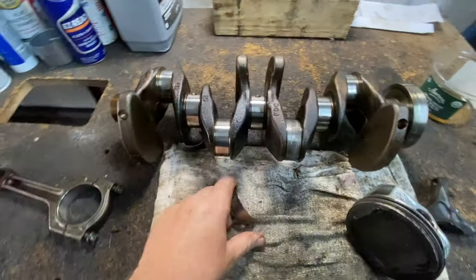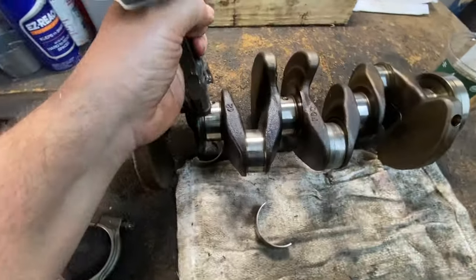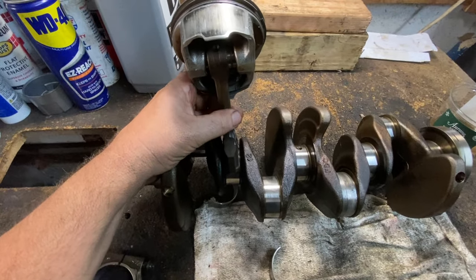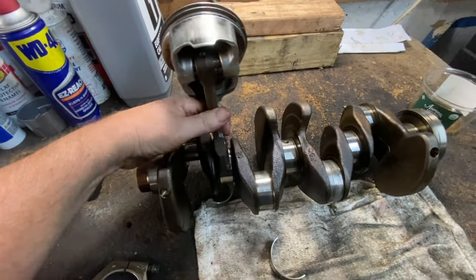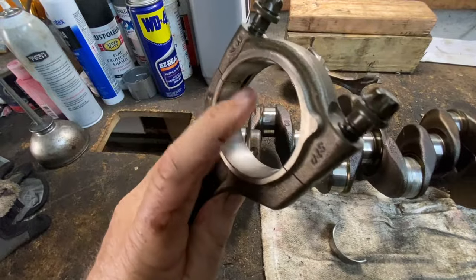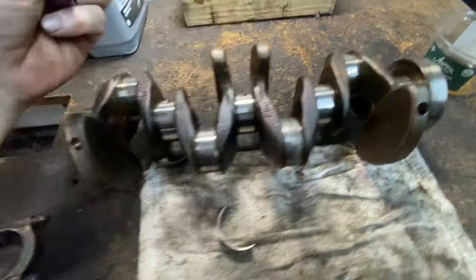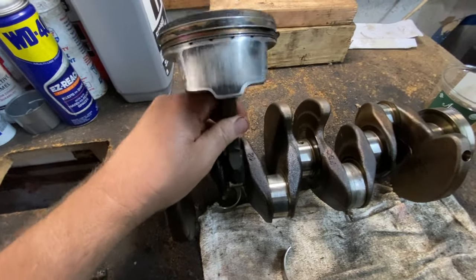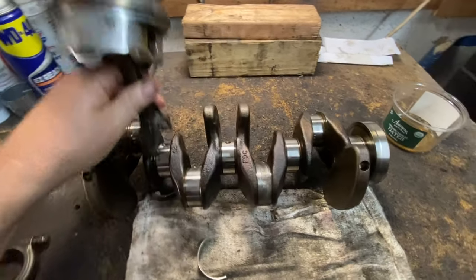So where does the knock part come in? Well, as it's seizing up, it's going up and down, up and down, up and down, and as the oil starvation is there, it starts to heat up. There's a couple of ways it can do it. It can rip the bearing off completely, where like in this one, you have no bearing at all. And then with no bearing at all, now you have more clearance in here, and you hear that noise. That's the rod knock. They call it engine knock. That's what that is.